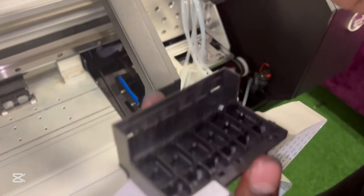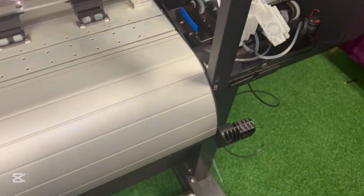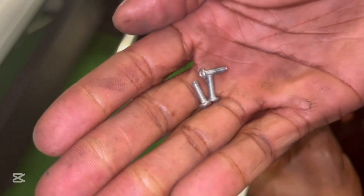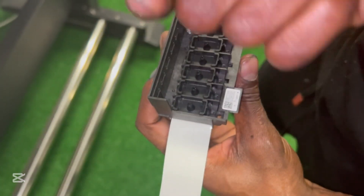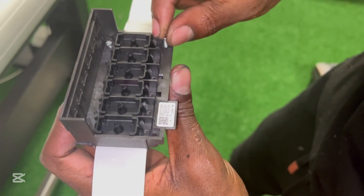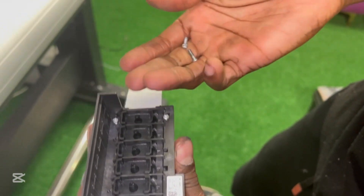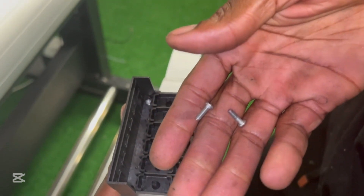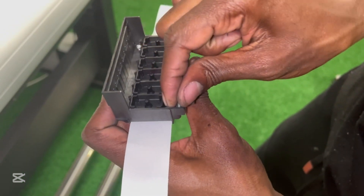Now I'm putting the head. I've put here what are called head screws and I'm going to show you what they look like. As I plug in my head screws, you notice they do not have any washers at the front here at the top. That's very important because you do not want your head screws to not be able to fit all the way down, and it's really important that they all be the same size — otherwise if one is shorter the other is higher, your head is not going to sit properly.